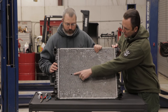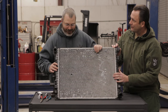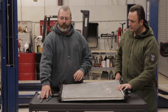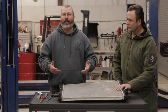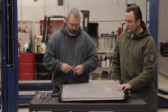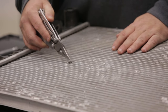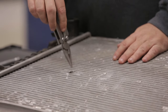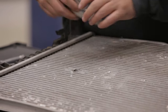We're going to go ahead and lay it down. Normally you'll see people doing this with stuff they may not have out downrange. We're actually going to do it with a Leatherman. What we need to do is crimp off the rows that the fluid flows through. I need to clear out and rip out some of the fins on each one, and then I'm going to take the row and start crimping it and rolling it up on itself.